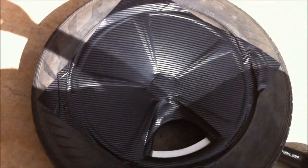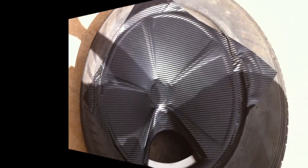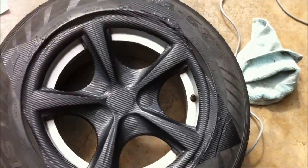And when you put the slices, you know how I mentioned you could put slices in the vinyl just so it folds easier? Don't put them right up to the edge. Leave enough to curve around and then have it sliced, because otherwise it'll open up and leave a gap in the edge. Alright, I will do the other 4 and then I'll give you the next step. I've lost count of the steps already, so I'll just refer to them as the next step. Okay, then I finished that step.